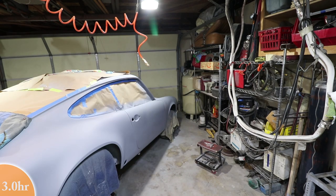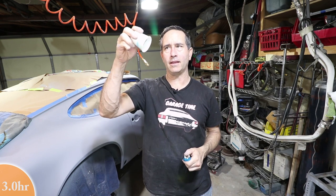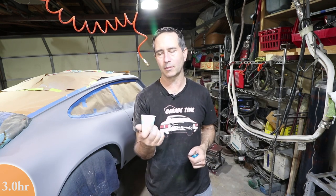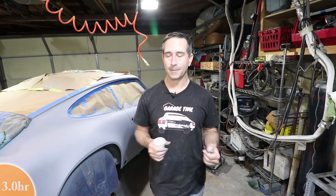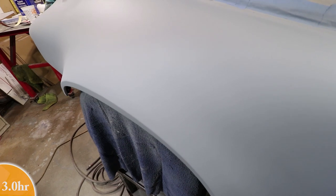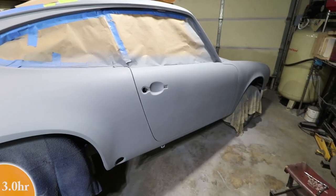I just finished cleaning my spray gun and that stuff dries really quick. I let the garage air out a little bit, but whatever's left in there will not pour out. On the last coat I had a little extra, so I tried to spray a third coat on just a couple of areas that needed more and it basically wouldn't even come out. The SPI data sheet is right on — you've got about 30 minutes to work with this stuff, otherwise it's done and you've got to clean the spray gun right away. I used my good spray gun, the Warwick, but I ordered a larger tip — this is a two millimeter tip that comes with the cap, the fluid nozzle, and the fluid needle. That really made things work a lot better. It laid down really smooth on the car — really no lumpy orange peel, just nice and flat with a couple little nibs here and there from dust. This is really smooth, but it dries to a really dull finish right away.